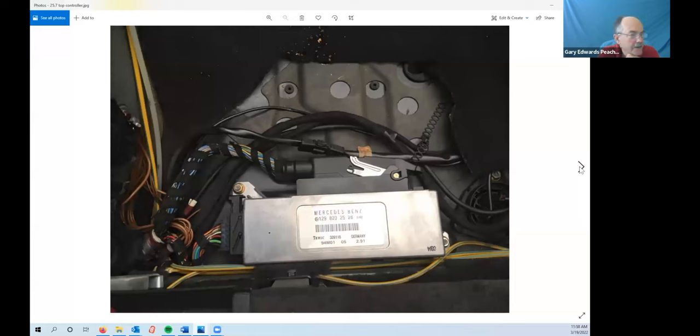Also, when you're taking off the trunk interior to do the tonneau lift and bow lock cylinders, you have to be very careful about where it interfaces with the rear fuse box because it'll break the tabs off that hold the fuse box cover. You've got to pull it down before you go across that or you break those off.